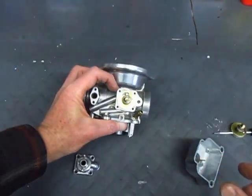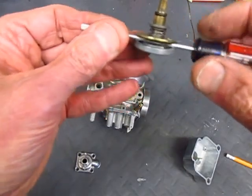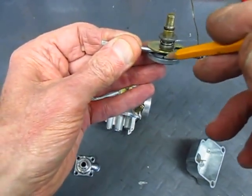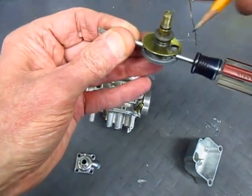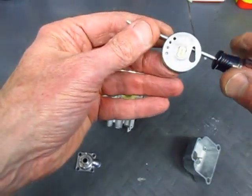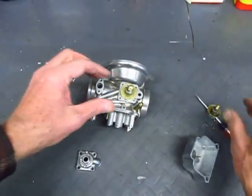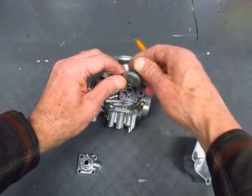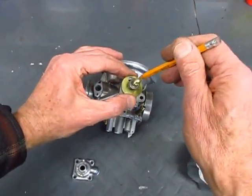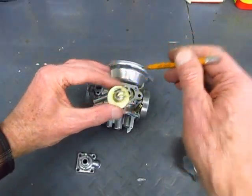To see how air and fuel get together, I took the other choke disc and pried up the brass plate from the metal body. If you look carefully, you'll see there is a circular passage cut into the body that connects with the oval entry point for the air. As I roll it over, that passage actually goes all the way behind these fuel holes. When the disc opens up, the little fuel holes are lining up with the fuel entrance, and that passage pulls fuel up through the standpipe and through the fuel hole to mix with air in this chamber.